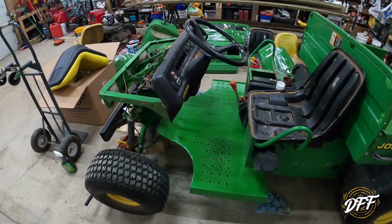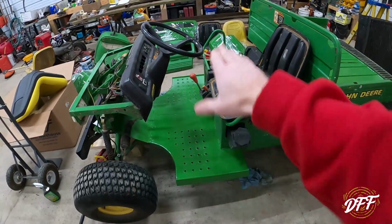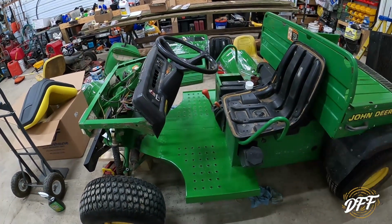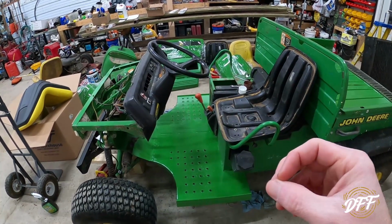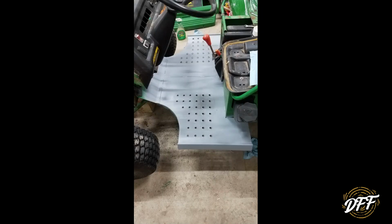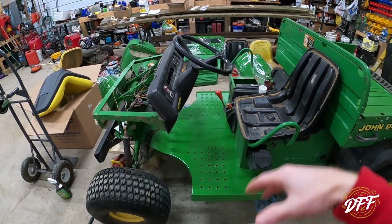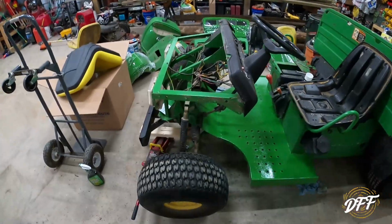And then the floor, I got the floor painted here. This did not really have any rust on it. It just had some weird spots from people's feet. So again, same thing. Again, not a restoration. So I just used that same wire wheel. And on this surface, I used a self-etching primer. I think I have a picture of that too. I'll throw that in. And then again, painted with the John Deere green paint. So 2 coats of primer, 2 coats of paint on there, and I'll double check. I don't know if there'll be any spots I'll have to touch up. So those items are done.